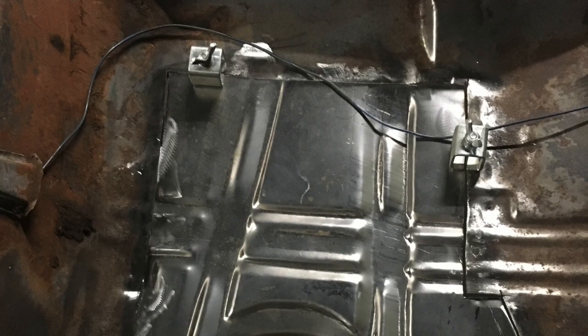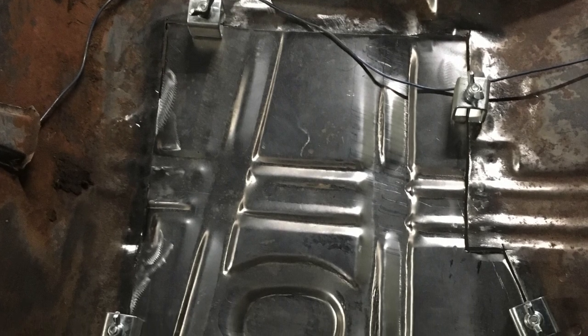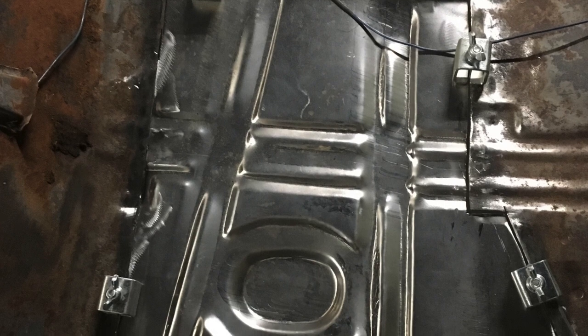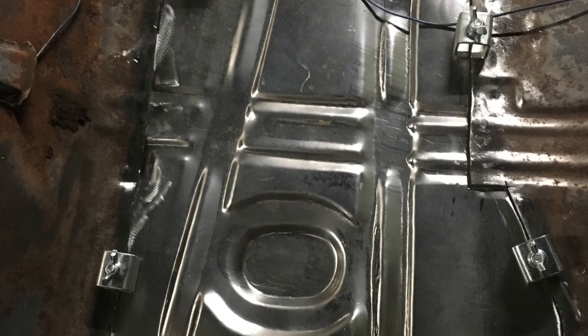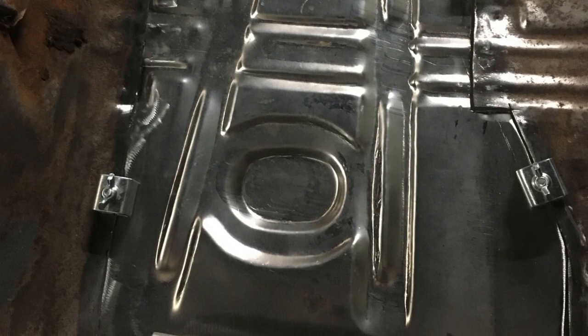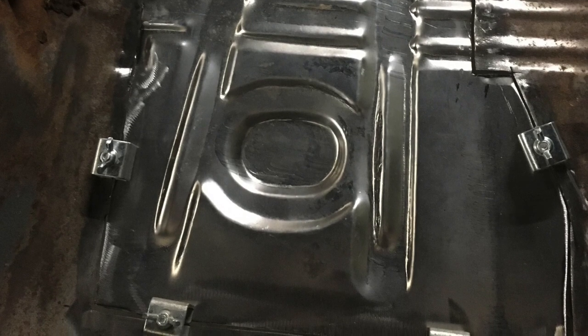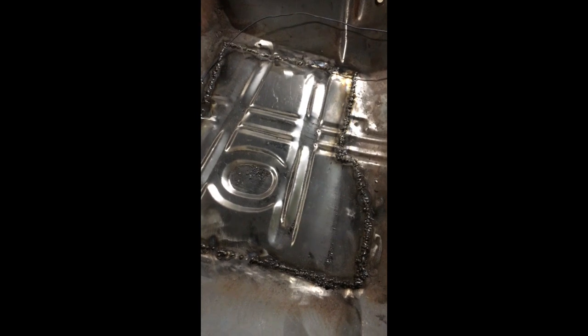This is what it looks like after I got that panel done — my first weld on the car. It probably took me five hours to get this to sit in here. I used these little clips borrowed from a friend, though I think I'd just use magnets in future welds — that worked better. I was feeling like a stud once I got it welded in, but this was a horrible job and I'll explain that in the next clip.